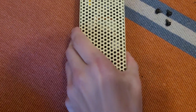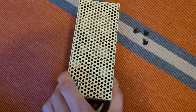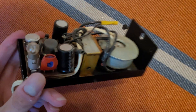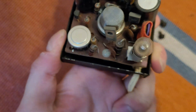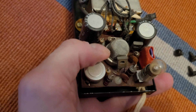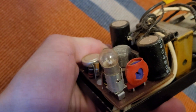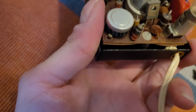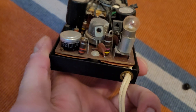The screws were literally hand-tight, so it didn't take much to get them off. Let's go ahead and remove this little cover. Oh wow — oh wow, there IS a heat sensor right there! So it looks like this one has a Delta Alarm horn, a transformer in the middle, and that is the gas sensor right there — it's like an electrochemical sensor. And there is a heat sensor right there as I mentioned, which I did not see from the outside. There's also a light bulb which I'm guessing is the indicator lamp.